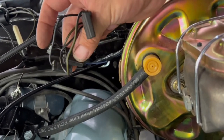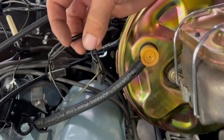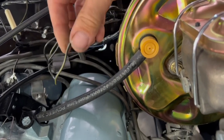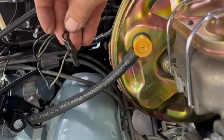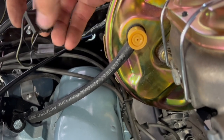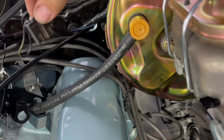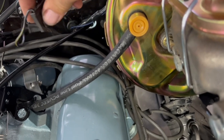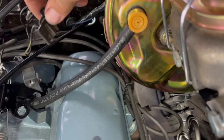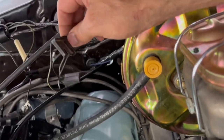There are five wires right here — three go to the wiper motor for high speed, low speed, and a constant power of some sort. Then there's a two-wire plug to check out: the black and yellow with a black and white tracer. These wires go to the washer pump — it should be a power and ground when you push in on the wiper switch for the wash function. I know I have voltage there because I heard the click click click of the solenoid.